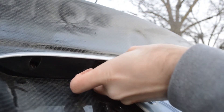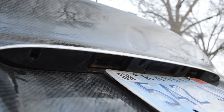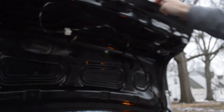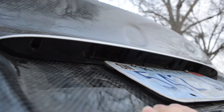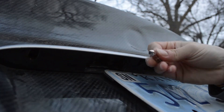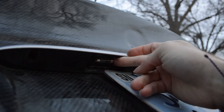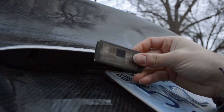It looks like the lights are a little corroded — they've got some gunk on them. So what we're going to do next is clean out the housing and put the new bulbs in. All right, we've got it all cleaned out. Here's the new bulb. They basically just clip in to these little holders here. You just slide the first one in, which is a little more open, and then you snap the next one in. Then we take the cover and put it back on.